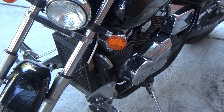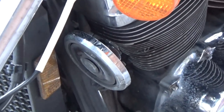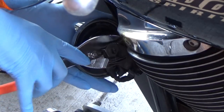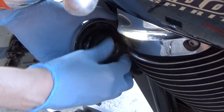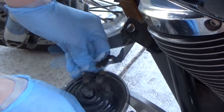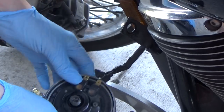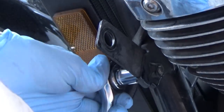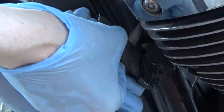The stock horn is really kind of a little beeping thing — like a little beeper, kind of like on a Model T. It's mounted on the frame with a bracket, and the first thing I had to do is check the mounting. When I took the stock horn off, I could see that the terminals were going to plug right into the air horn — no problem there, didn't have to change them out. And the bracket that was mounting the original horn, I had to take that off and figure out how I was going to make up a new bracket to mount the new horn, which has a very different kind of mount.